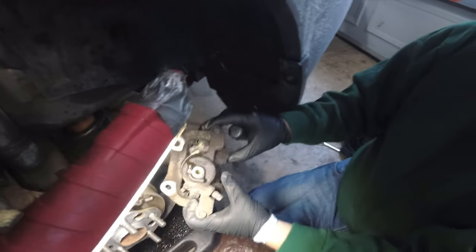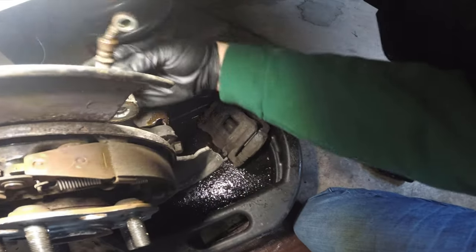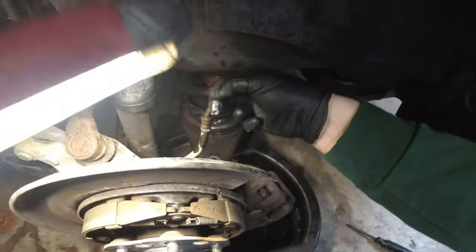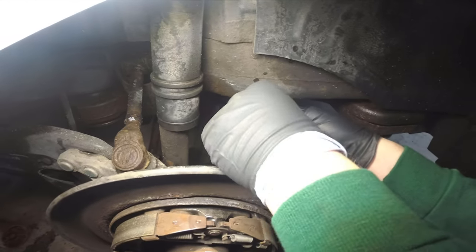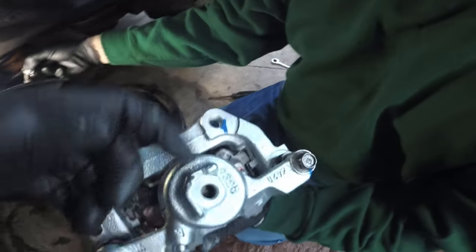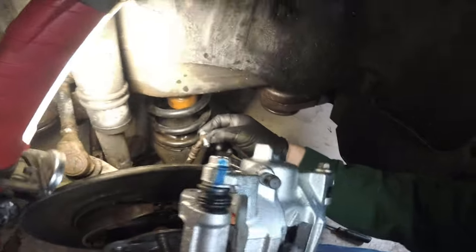Drop it in the pan and check front and back to make sure there are no washers on the brake line. Put the banjo bolt in with the washer on the back side — the washer on the opposite side goes on after so it's sandwiched. Now install the caliper. There's a groove where the brake line sits; if it doesn't go in all the way, tightening the banjo bolt will press it in. Make sure the bleeder screw is facing up — if not, you have the wrong caliper for the wrong side.